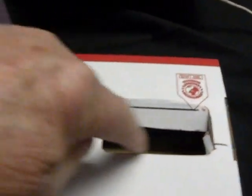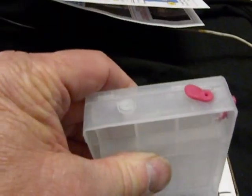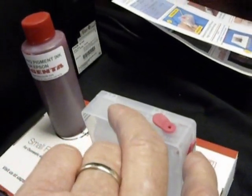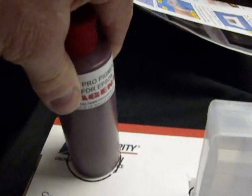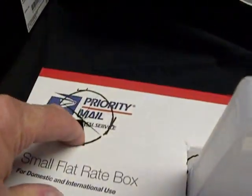What I've done is I've cut out a little square in an old box so I can put the cartridge in. Then there are two plugs — this one is the air plug, which needs to be out when you're using the cartridge, but for filling, because I don't want ink to drip out the side, I just leave it in. At the other side of the box, I draw a circle and cut it out so it'll hold the bottle, just like cutting a pizza.